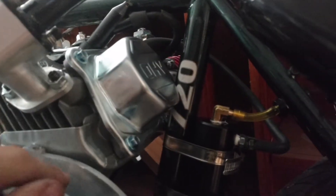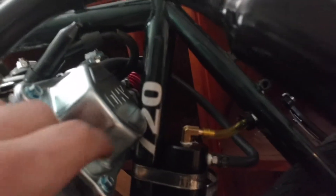Pretty much what it is, it's just a little itty-bitty can — maybe four inches long, inch and a half wide, holds probably maybe half a cup. When you really run a small engine hard like this, it's actually going to spit up a little bit of oil into the valve cover here, and it comes out of this hose right there. I rigged it so that the hose would come out around and right underneath the back fork. The oil catch can does just what it says — any oil that comes out of the valve cover goes into the can and can actually be reclaimed.